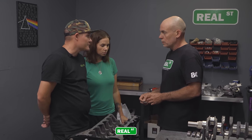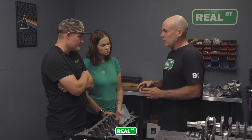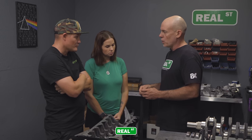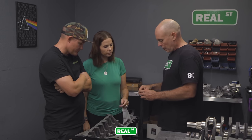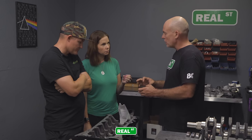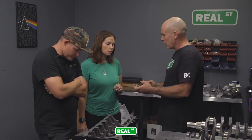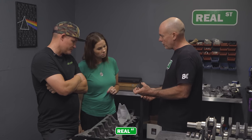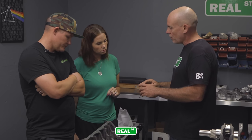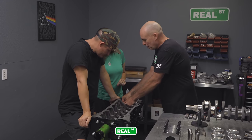Oh, no. This layer of the bearing is so thin. If you get it wrong and it's tight, all this stuff gets destroyed. It's too soft. We could damage this with our fingernails. So what is this made out of? Is it aluminum, or is it so soft? It's a multi-layer bearing. So there are different materials and different surface levels in the bearing. Not every level is the same, because you've got to have a strong structural backing to it. Top layers are going to be softer, because if there is trash, you would like that trash to be embedded into the bearing.